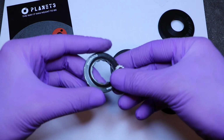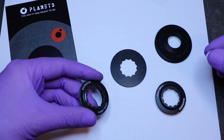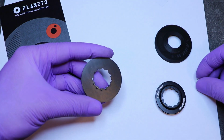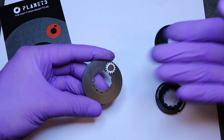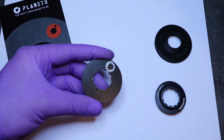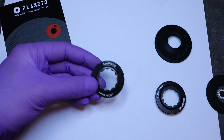Okay, so if something happens to your ring gear and it, let's say, gets crushed by a branch or falls off the bike or whatever, and you have the Sun Gear left on top of your lock ring, you can just leave the magnet in place and it will rotate with the wheel in a 1-to-1 ratio and you can still get home. Your sensor will be picking it up. The bike just will be restricted as it usually is. Okay? So please use this lock ring because steel is less likely to strip and it's magnetic.